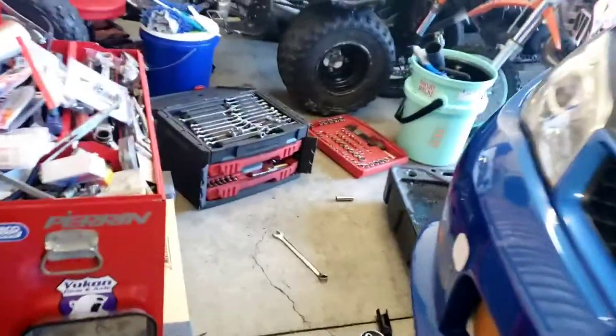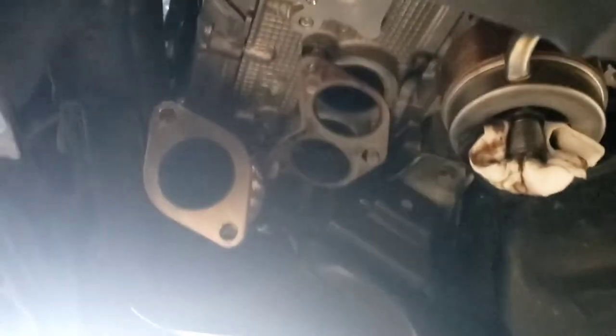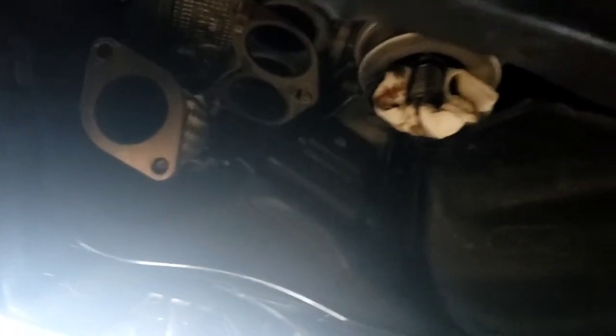Okay, so as you guys know, I'm putting that stuff on today, right? Disconnect the pitch stop mount, just to make it fast and easy, right? And then, obviously, the header is off to the up pipe, the oil filter's off, drain the oil, block with a floor jack on the transmission so you can get it high enough to reach those back four bolts that run along this bar, back in there. They're hard to see. You know they're there. If you're doing this, you know they're there. They really suck.